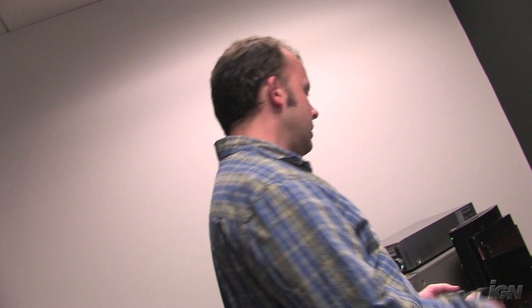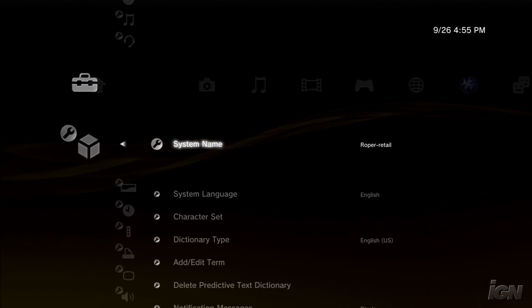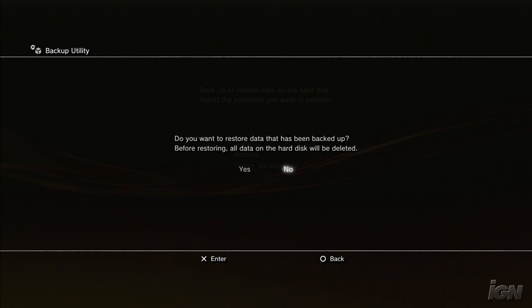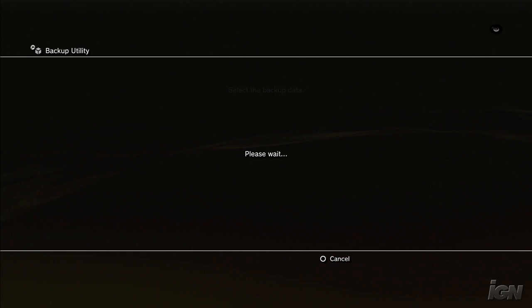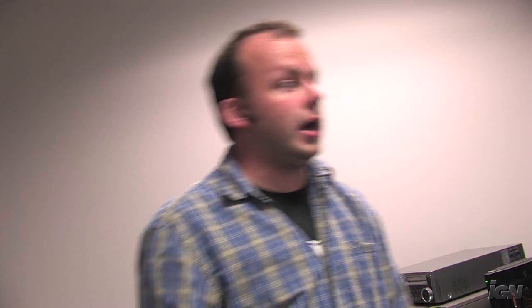So if I didn't have a backup drive, I could just put in a flash drive and copy my saves over manually. Since I did back up everything to my drive, I can just plug that in. Now I come back over to system settings and choose the backup utility and just pick restore. It'll say do you want to restore everything — everything on the drive will be deleted. Pick yes. You have to keep confirming yes. It formats the drive again and now we'll just have to sit here for another hour. Once everything goes through, my system should be exactly as it was before, except now I'll have an extra hundred gigs of hard drive space.